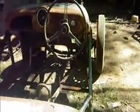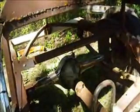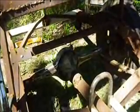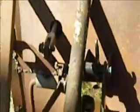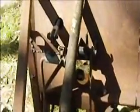And if you look down there under the dash, you can see the pedals. Maybe if I can just get the light a little bit better, you might actually be able to see them. The axle there is actually from a Morris Minor, which has had the ends from a Morris Z diff grafted on so that I will be able to use the original wheels and brakes. Okay. Standard Morris Minor setup.